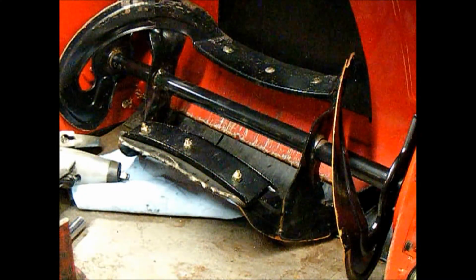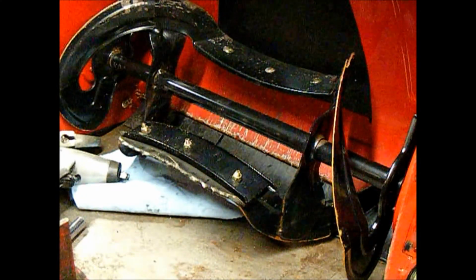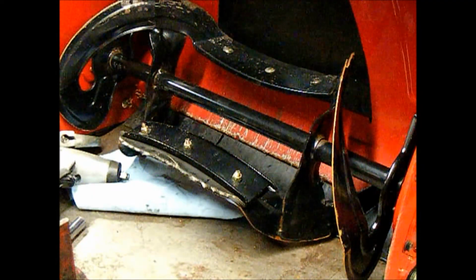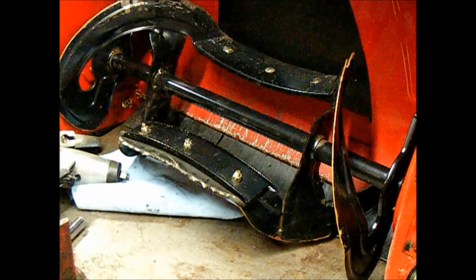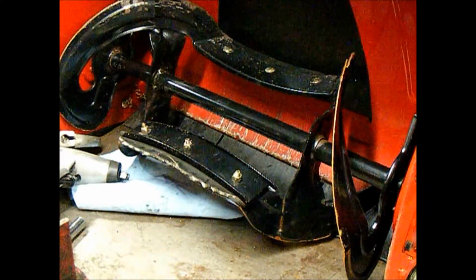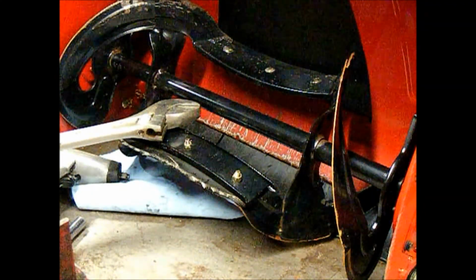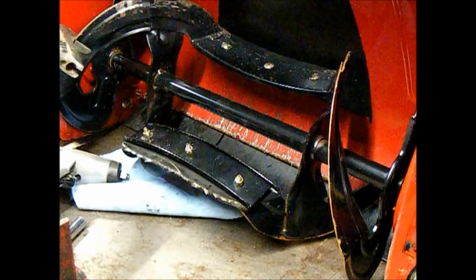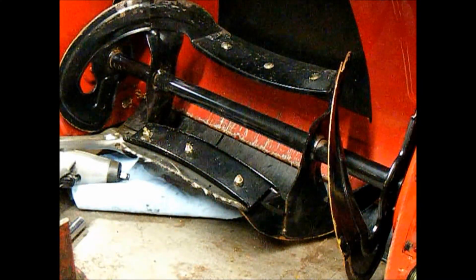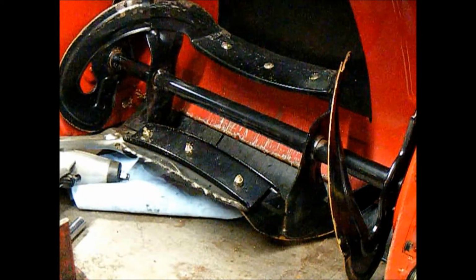And those curb boxes are supposed to be flush with grade. Well, this customer, his curb box sticks up about 2 inches above his driveway for God only knows what reason. I guess somebody didn't get their measurements right. So anyway, he found it with the snowblower, and he bent this right side auger. And I managed to get it straightened out with a 15-inch crescent wrench by working it around, and it's straightened out well enough that it doesn't need replacing. He does, however, want the rubber paddles here replaced. Those have come in, so we're going to be replacing those.